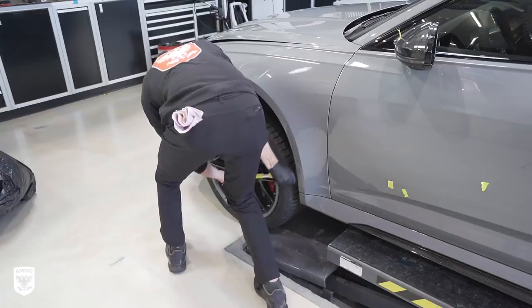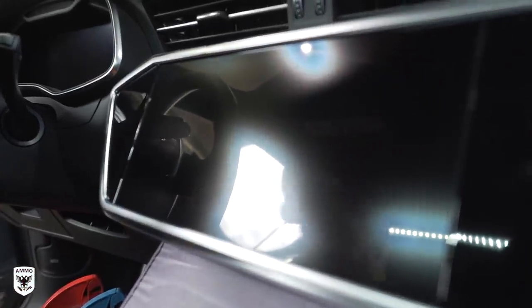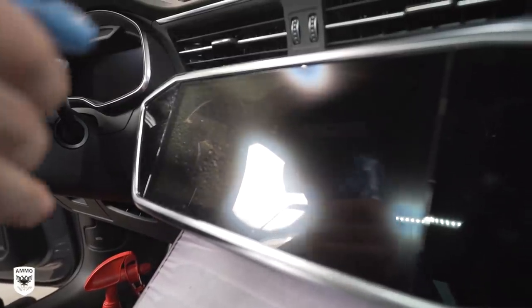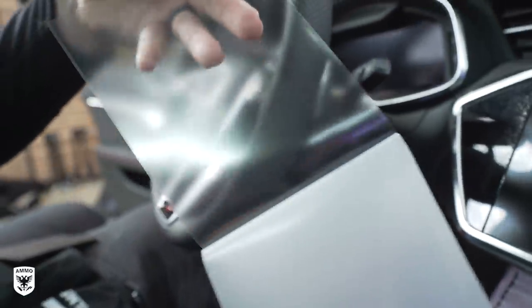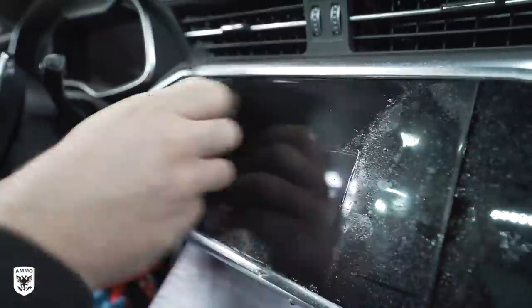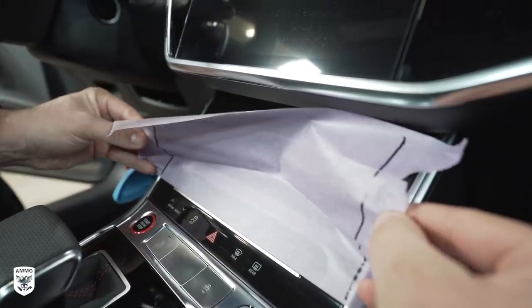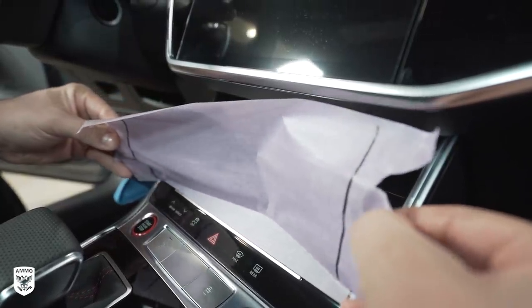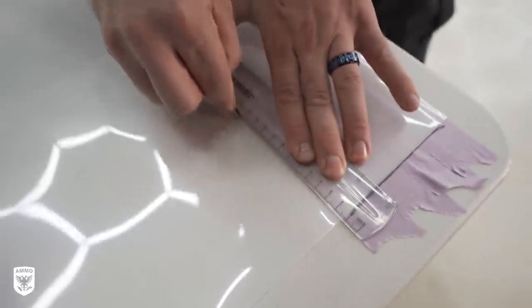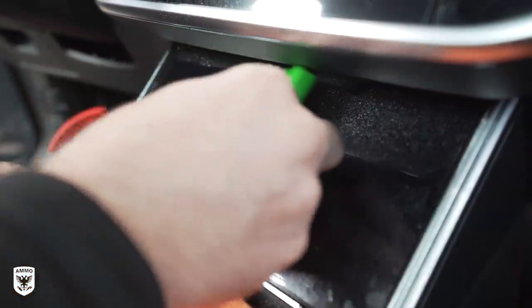Because of all the interior screens, I decided to surprise the owner with PPF over the many touchscreens on the center console. First we cleaned the screen, then cut PPF to size and applied it with application gel. On the lower screen, we repeated the same template technique as we did on the above screen, but because this was last minute, we didn't have any time to order pre-cut kits, so we did this on the fly. This particular film is antimicrobial and designed for touchscreens. With our makeshift template on the table, we pulled the film over it, measured, and cut the appropriate size. We cleaned it, applied the gel, placed the film, and squeegeed it into place.